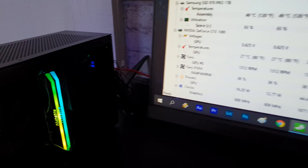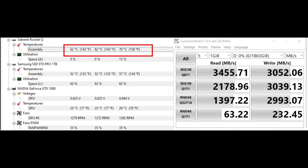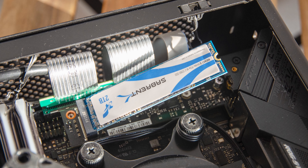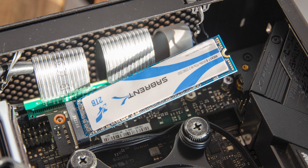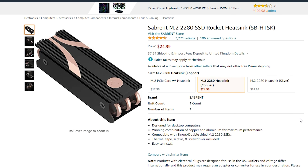Now let's talk about the SLC cache because this is really interesting. Usually most QLC or TLC based M.2s at even 1 or 2TB in size will exhaust their SLC cache and then write at their native NAND speeds. This SLC cache rarely approaches 80GB in size even on big capacity drives — hence my test of 109GB. But the Rocket Q 2TB drive keeps pushing all the way through, so it must have an even bigger SLC reserve. As you can see there was no large dip in performance and the SSD maintained a respectable write speed. This is quite a pleasant surprise.